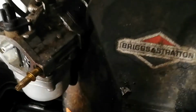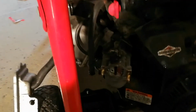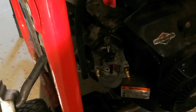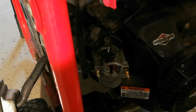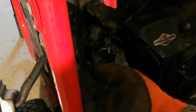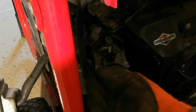So, see right there? See it turning? So that's how I knew how to take that off. That's how I looked at it and I could see that they were studs, so that's why I knew to take it off, because the nuts holding the filter housing on were actually screwed onto here, so that made it easy for me to figure that out. Just want to unscrew these.